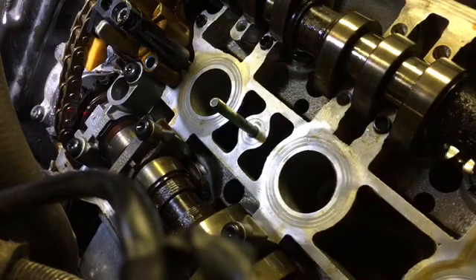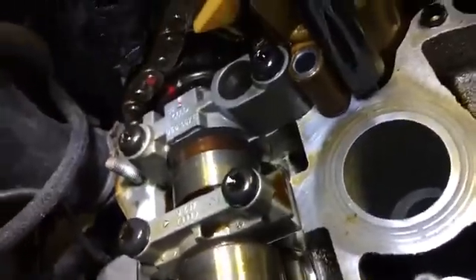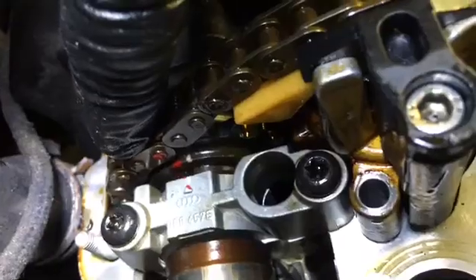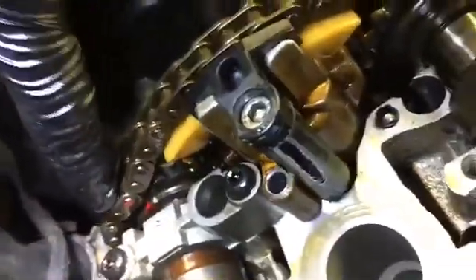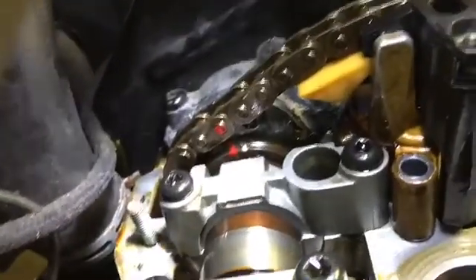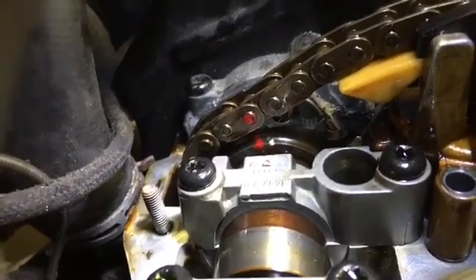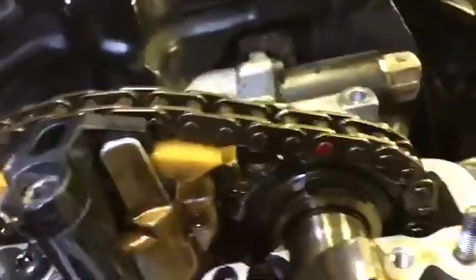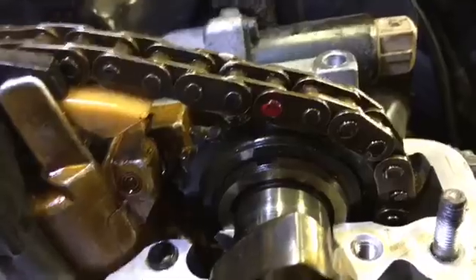That's how that works. Now I have my chain right where I want it to be — it's going to be kicked off to the left. Once I get everything tightened down and the caps back on, I'll have my 16 in between. The exhaust side, as you can see, is already tilted at the angle for the caps — kicked off to the left a little bit, which is how you want it. Then the intake side is going to be straight up. I'm going to put the caps back on.